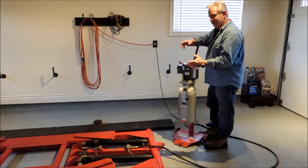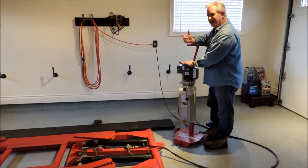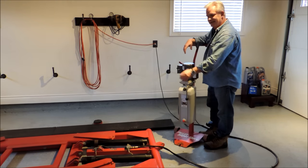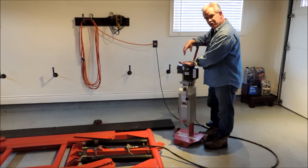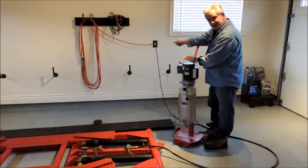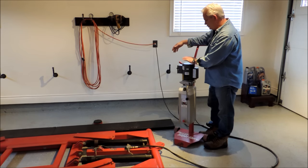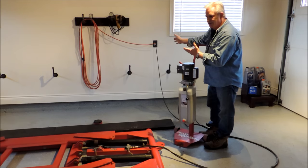With the scissor hoist, you get two things: the hoist and the power unit. This power unit comes in 110 volts and 220. The whole price of this thing — the whole package, these two pieces plus the little pads — is about $2,000 to $3,000 Canadian. The more expensive one would have 220. But I'd recommend the 110, because everybody already has a 110-volt outlet in their garage.